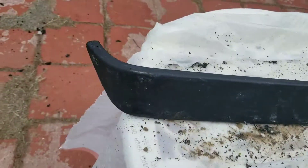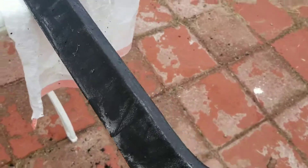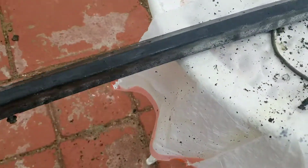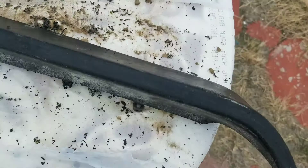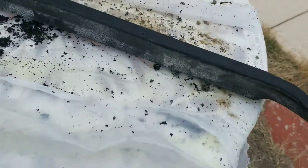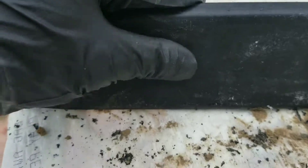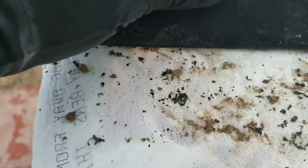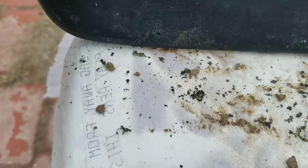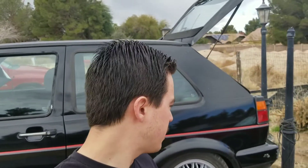After a little while almost all the paint is off. I'm going to rinse it off — this was about three, maybe four coats of the stripper. The white down there is other paint stripper that didn't really need to strip since it's just texture. The problem is the previous guy painted it and sanded it smooth so there's no texture left. I think this is going to be a test candidate for me to retexture, and I do think I'm going to use this paint stripper on the bumper — I have plenty left in the can.